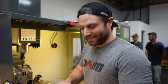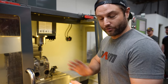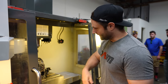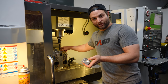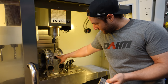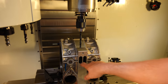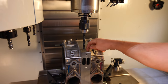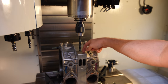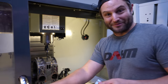It is finally time to make the first cuts and we're going to use drilling to our advantage — it doesn't wobble or have any real major issues straight down. So we're going to drill the two major holes for each of the injectors that go straight through this. You will be able to see it end up poking through the bottom. We'll show you that after the operation is done. You don't go back from this. So I'm going to do a spot drill on each of these and then drill straight into my very expensive custom irons.